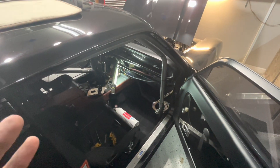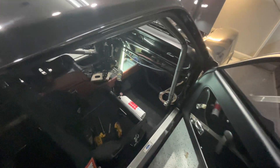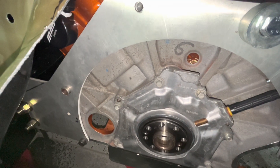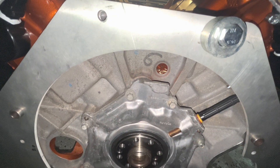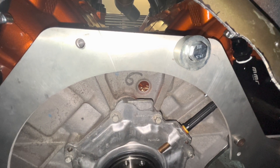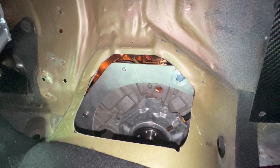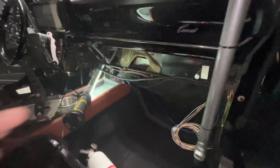I was thinking about an easier way to get those top bolts on the transmission, or if you ever need to get in there to access a sensor. Now I can easily access both of those bolts - that bolt's just in there for mock-up, the sensor's right there, and you can see a lot of stuff from up here. If you ever have to service anything you'd be working from below, but somebody could come in under the dash and get inside there. I'm going to line it out with door edge protector so you don't cut your hand, and I'll build an aluminum plate that screws on over top of it.